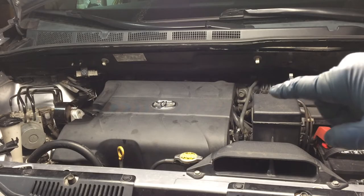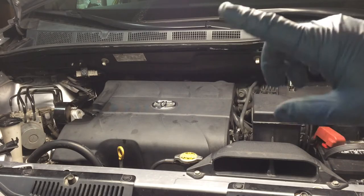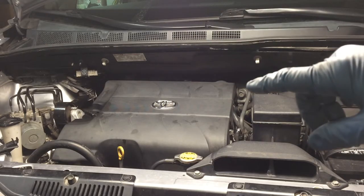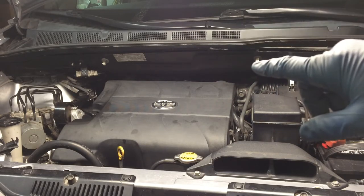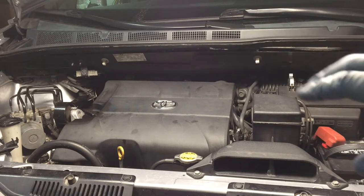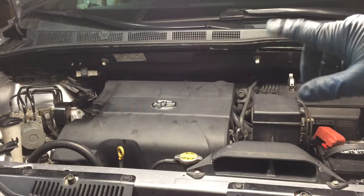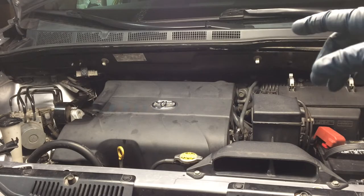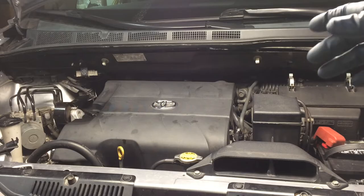We're gonna disconnect the throttle body. We'll take this hose out, take the cover off, take the surge tank off, take a couple brackets for the surge tank off, and that'll give us our access back there with this cowl off. You'll see every bolt for that job starting now. It's really not that bad to take off the wipers and all. It maybe only takes 15 minutes or so. So I think it's worth it to get the extra room, but that's up to you.